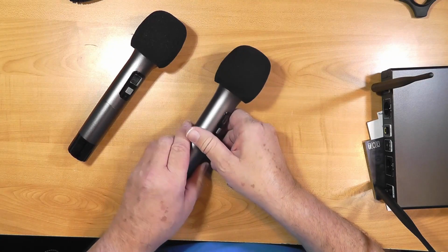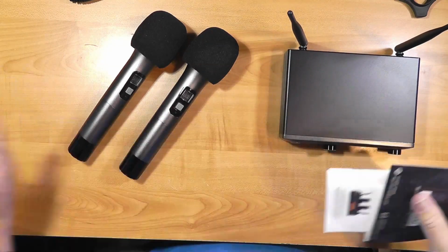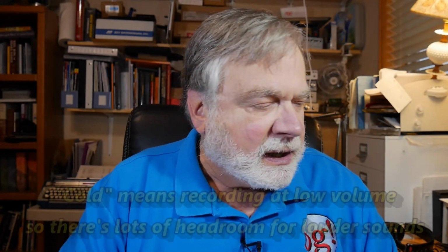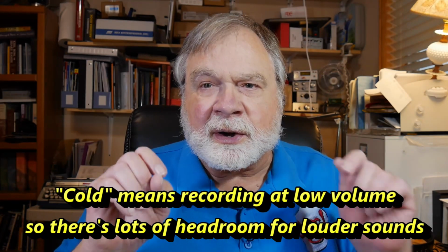So what we're going to do is hook these microphones up and then talk on them. And I'll let you decide for yourself what they sound like. I'll put this sound going through the same recording that I'm doing the regular microphones on. Normally when I process this, I do two things. I record kind of cold, and I first limit the thing to -8 dB, which takes care of the coughs and the peaks and things like that. And then I compress with a compression in Audacity to come up with nice sounding audio for the Ask Dave videos. We'll do the same compression with this. Now it's interesting to note these are monaural connectors. Monaural. So I'm going to have to get my mixer out, and we'll use the mixer to do this.